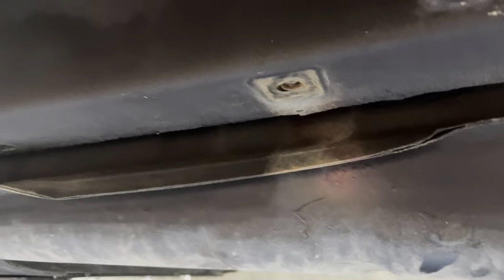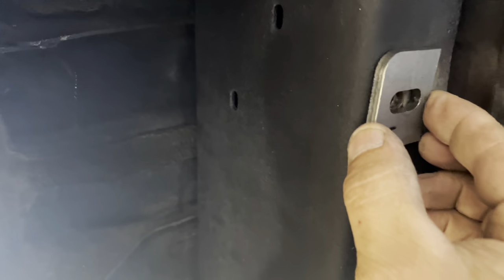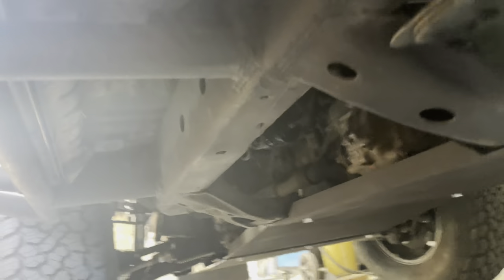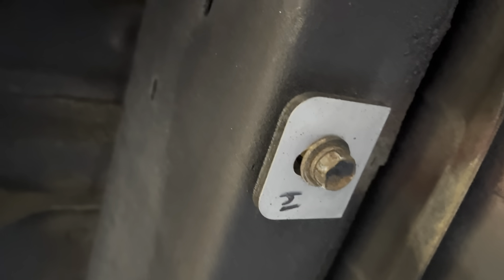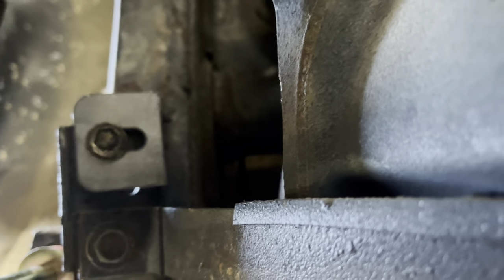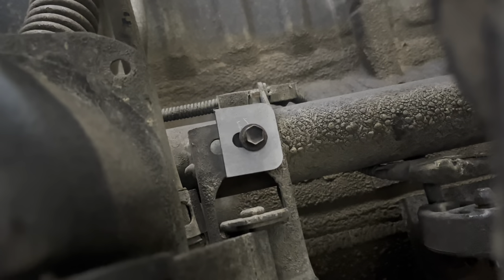See how that goes in there? We're just mocking this thing up right now. After we put on this first piece, we're going to loosely hand-tighten these in place. Front of the tank — number 12 — we've got that bracket in there loosely. And the 14s: we've got one on the driver side rail, one on the rear driver side of the fuel tank, and another one on the passenger side of the fuel tank. And that is it.